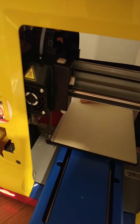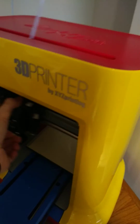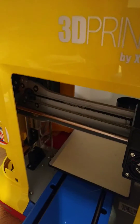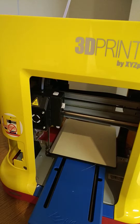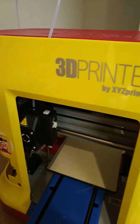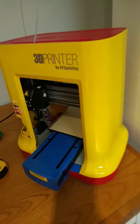We've got a red light right there. So I believe what is happening — I'm not an expert, this is the first one I've ever gotten — if I move the printhead all the way to the right, the Z-axis moves up and down just a little bit. When I turn it on, it moves the printhead all the way to that side and then it jams. My guess is that it's not hitting its limit stop on what I believe is the X-axis. It's not realizing it has hit its limit stop, and the motor is just jamming, trying to shove the printhead further than it can physically go.